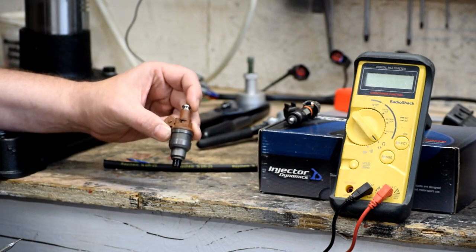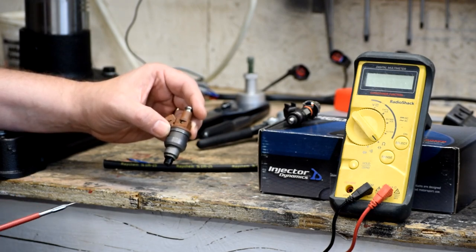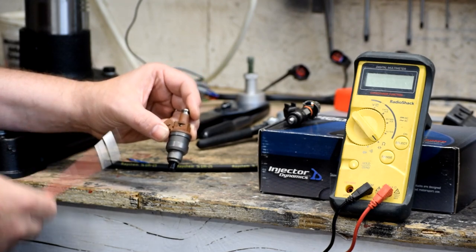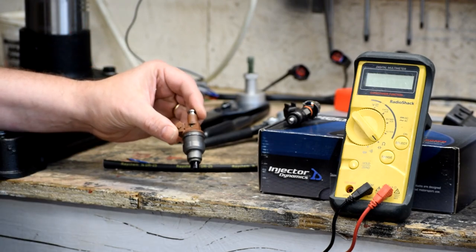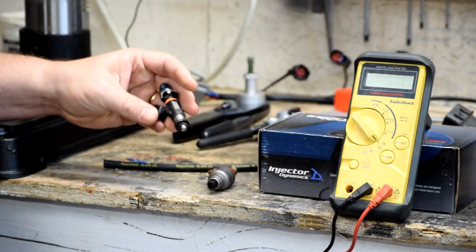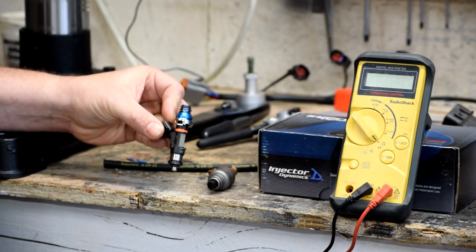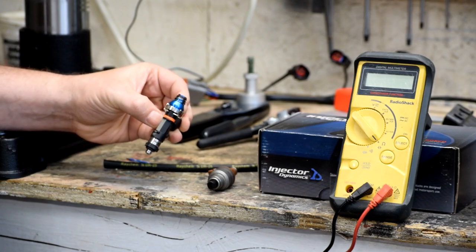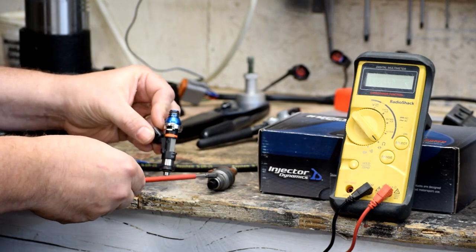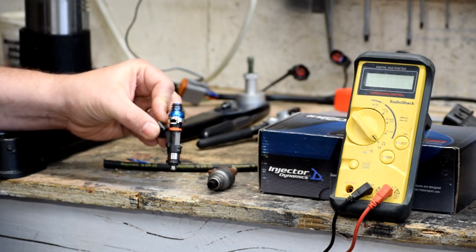That was great for the 1990s, but technology has since moved on. If you need a bigger injector because you're running bigger turbos, a freer flowing exhaust, or anything bringing more boost, you no longer need this 1990s technology. What we've got instead is this bad boy — a Bosch Motorsports high impedance injector modified by a company called Injector Dynamics to provide a little more flow. This is a fraction of the size and weight of the old one, but it flows way more. This is a 725 cc per minute injector; the old one is a 425 cc per minute injector — this one flows almost twice as much.